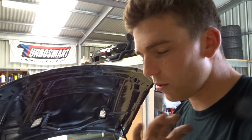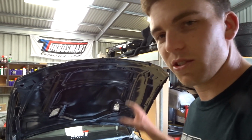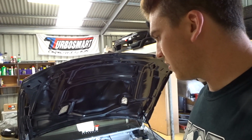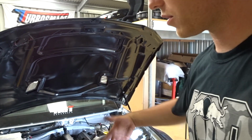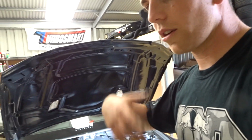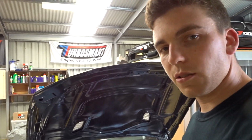I'm nervous as hell. I always get nervous because you've done such a vital part of the engine. Even though you checked it, triple checked it, it's just nerve-wracking. What I do is always start it without the spark. Disconnect the trigger sensor, so obviously it won't start up on you. Just turn it over, make sure all pressure's there and everything's all good. And yeah, kick it in the guts, bleed the coolant system, and let's do it.